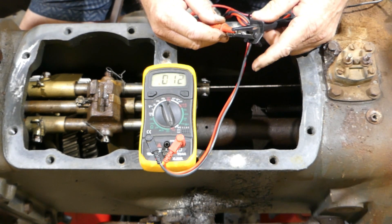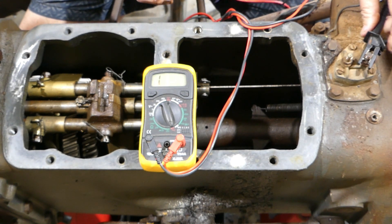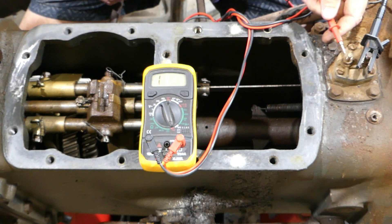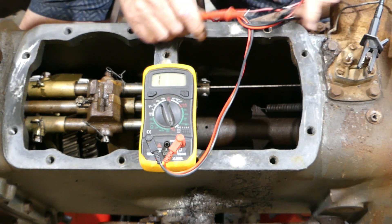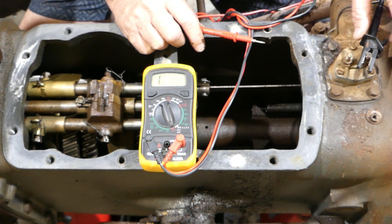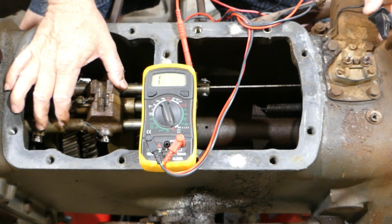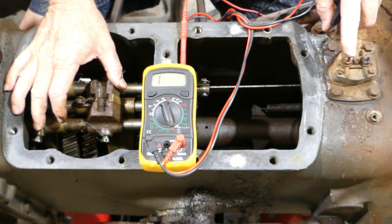That's a good way to test it and just see. This switch wasn't working, so a quick way to test it is pop an ohmmeter on either of these terminals — you can see that terminal there is even loose. We pop an ohmmeter on there and put this against the other terminal, and what we're showing there is that there's no continuity here. One of these comes from your battery — it's the one going to the starter, whichever way you've got it wired up. It comes from the battery to here, then from this other stud across to your starter motor. When you pull the gear stick back to engage your starter, it puts power between these two — it joins them up, that's all it does.